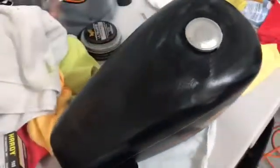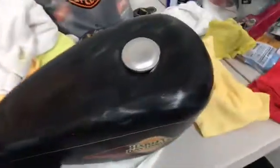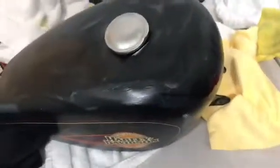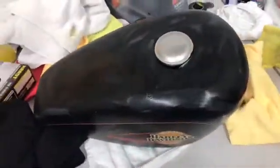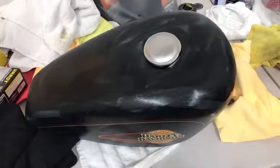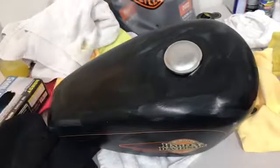And unlike the other high-tech wax, you want to let this dry real good. You want a good layer of wax to work with. Next thing I'll do is I'll strip it off with this again. But once that's done, then I'm going to use a real soft wool buffer to really bring the shine out. So this needs to set for about 10 minutes to dry.